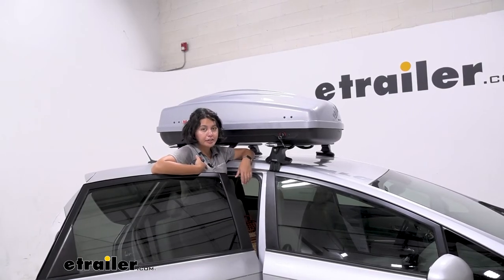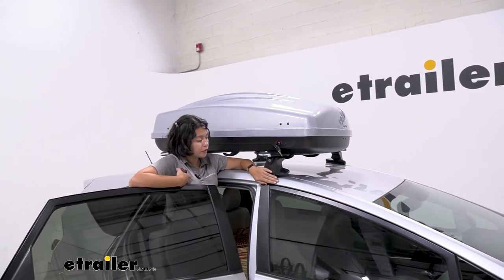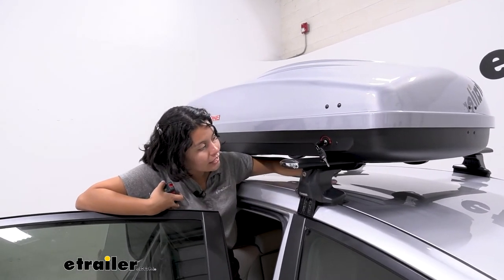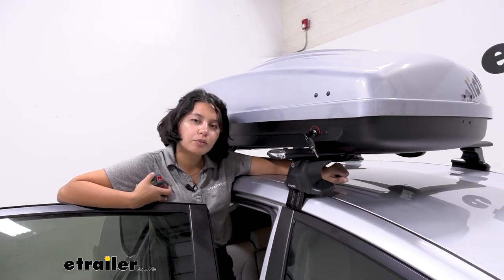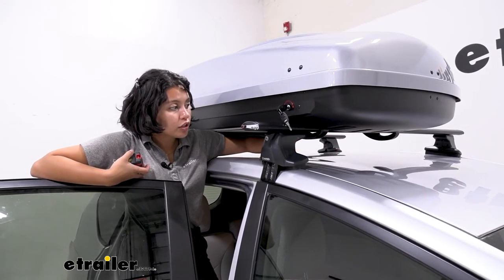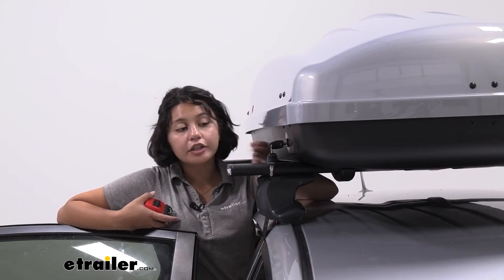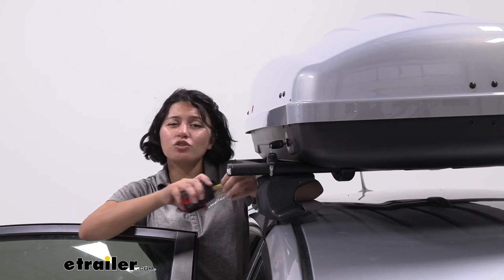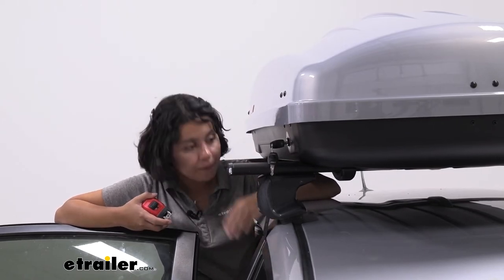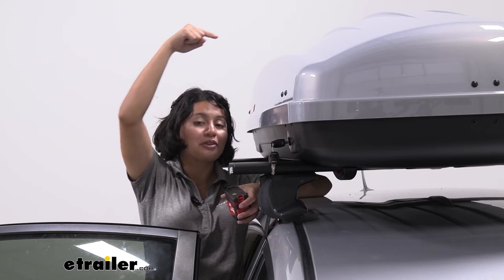I have the Inno Aero crossbars that are 54 inches long. With aftermarket roof racks on naked roofs, you can't adjust the crossbar spread — I almost barely fit with 29 inches of spread, so I had to make sure the clamps were just on the crossbar enough to be tight even though it looks like it doesn't fit on the other side. That's still super secure. Just make sure your clamps are facing outwards on your crossbars. If you have overhang on your bars, you really just need two inches of space — I positioned mine towards the inside for aesthetics, but having it further out makes it easier to access and gives you more space on the other side for accessories.